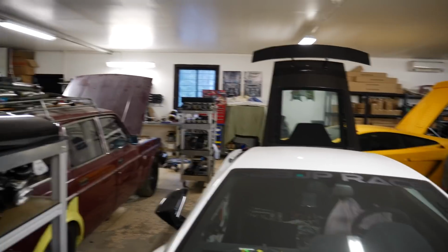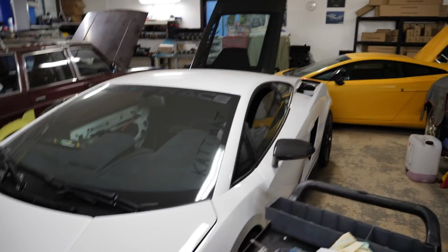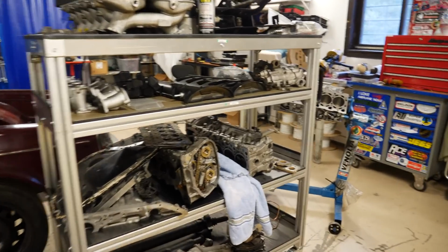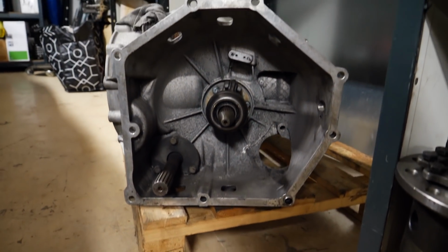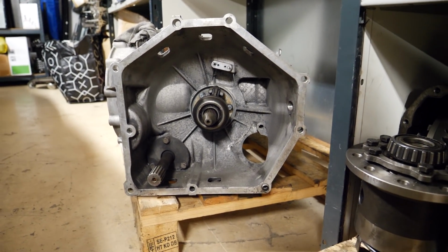Both the V8 and the V10 are the ones that will fit and have this kind of bolt pattern as you see here. And actually I think it is maybe journalists or maybe Audi themselves that fool the people, because I could read some articles when Audi introduced the V10 in some normal sedan cars. It says that it is a detuned Lamborghini engine inside it. Yeah, many parts are similar and maybe the same, absolutely, but the gearbox looks like this. This is the bolt pattern for it, and I have not seen any other Audi that has that one. But if you have proof of that, please send it to me. That would be cool, even though I now have my solution for the gearbox.